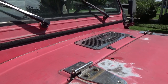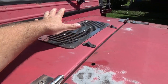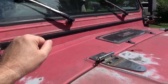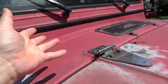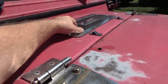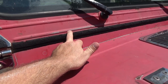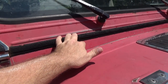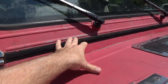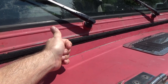On these rigs, you've got two different places you can most commonly get water from. It's going to be down inside this grill here, which is where you get your fresh air from whenever you set your heat and air conditioning. It pulls air from the outside into the cabin area from inside here. The other place is this seal right here, and you can see mine's had better days. I've got a new one in the house, I just need to get around to changing it.